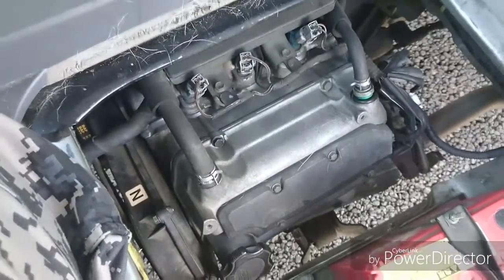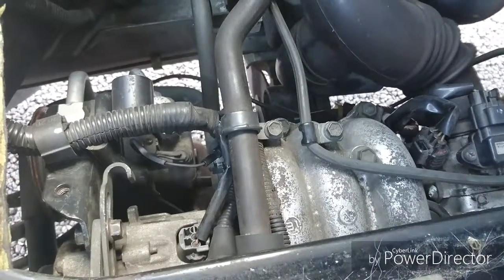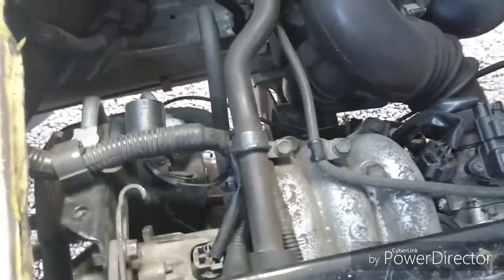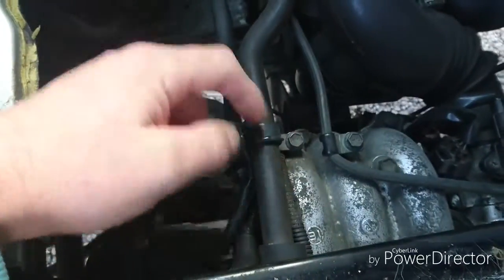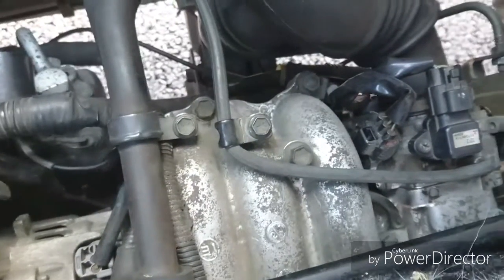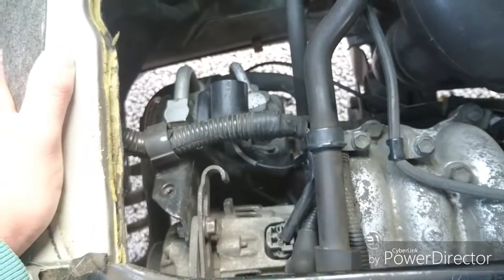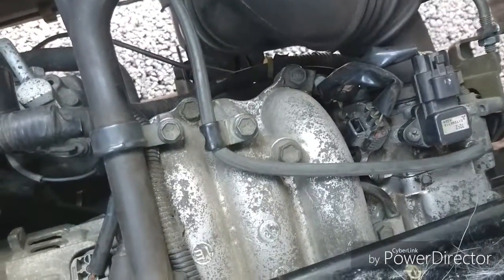There was a carburettor model with its own intake manifold. The middle one is the type in my K truck — it's very similar to the carburetted model in that the runners are quite short. This later one has extremely long runners with throttle bodies, a plenum, and then another plenum before the engine — a very big, heavy, elaborate setup. I believe it actually makes more power, probably something to do with emissions, but it might actually make more power.